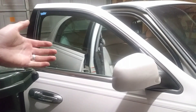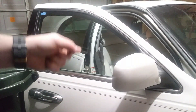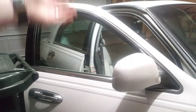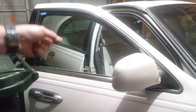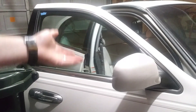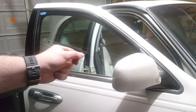A problem with some of these older cars is the tracks that the window slides in start to get old, starts to get brittle, and lubrication dries up over time. You put these windows up and down and they start getting slower and slower. A lot of people think the motor in the door is going bad, but that's not the case. What's happening is that track is causing a lot more friction on the window, making it much more difficult to pull down and roll up. And eventually it causes so much stress on the motor that it will cause your motor to burn up.